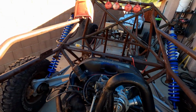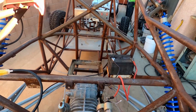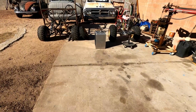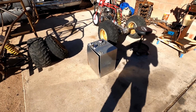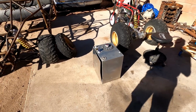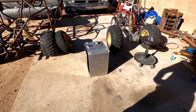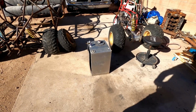Yesterday, I don't know if you watched my little video from yesterday, but this being a real long run here, a fuel line, I wanted to put some air in the fuel tank to push it along, so it'll prime the pump and see if the fuel pump on that motor even worked. And well, I had about 10-15 pounds of pressure in my air tank, and so I didn't think anything of it, but yeah, I'm putting air in this thing and this tank exploded on me, which was not a very fun thing.